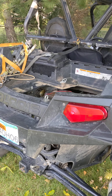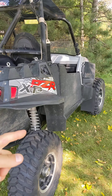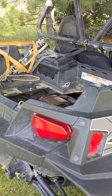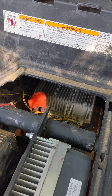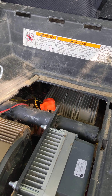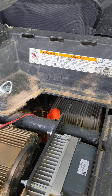I don't have a winch on this machine. I find a smaller come-along much handier because I can pull from the back, from the side if it rolled over, or even pull somebody else out with a strap. As for whether you can use a winch — the limiting factor is your DC-DC converter. This one has about a 60 amp maximum. A winch might draw 80 to 200 amp peaks, so you may want to add a small 12-volt lithium iron phosphate battery in parallel with the charging circuit. For me, that adds too much complexity.